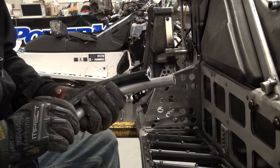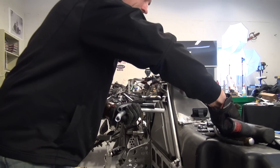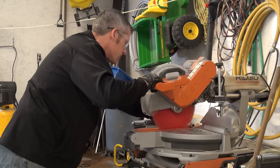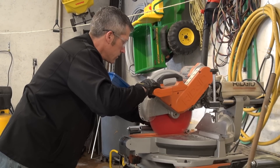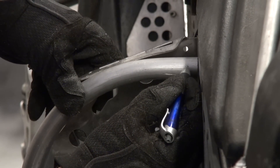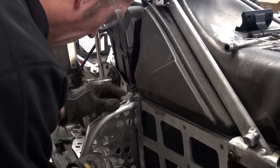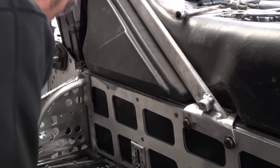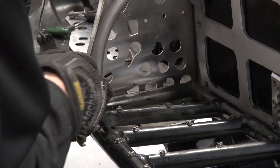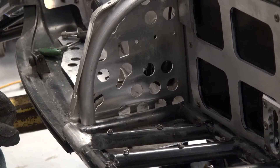This is one of those fit and trim kind of things. Aluminum is pretty tricky to weld and we're just using a spool gun on a MIG welder, so I'm going to have to make sure that this is as clean as I can possibly get it. Got to get all this powder coating off here before I do anything.